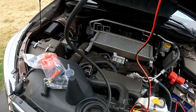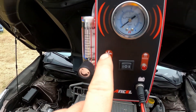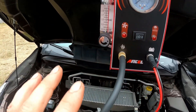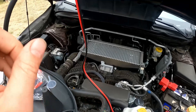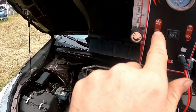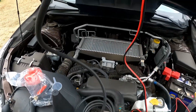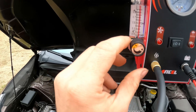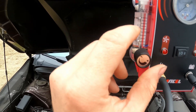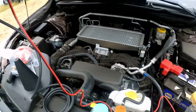Anyway, this is the main hose that I usually use for boost hoses — you hook it up here. This connection is for the fan and the compressor air. If you want to do just an air test without smoke, you press this button here and it will just send pressure down the hose. The compressor is built into it, and that bubble indicator is going to jump up and down — I'll show you in a second.